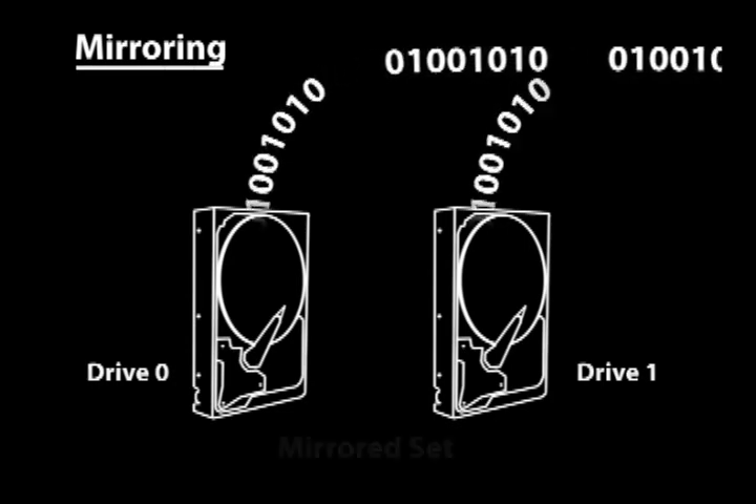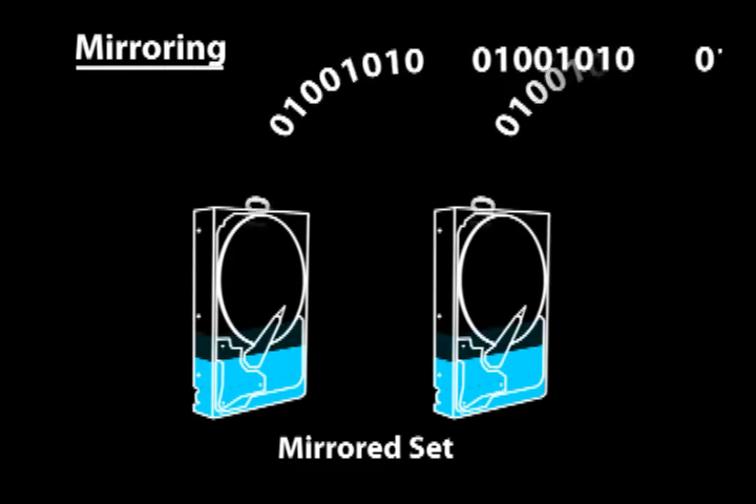The fourth way of configuring your drives in a network attached storage is to use RAID level one. RAID level one is called mirroring. Whatever information you copy to one of the drives is duplicated exactly on the second drive. This is great for redundancy because if one of your drives goes down, you put a new replacement drive in and it'll automatically get rebuilt to be like the other drive. One thing to keep in mind is that you're only going to get half of the space. So if you have two 500 gigabyte hard drives and use them in a mirrored fashion, you're only going to have 500 gigabytes of space. I highly recommend using RAID level one for the DNS 321 and DNS 323 so that you don't lose your data.